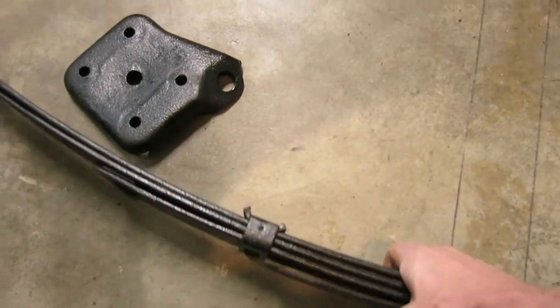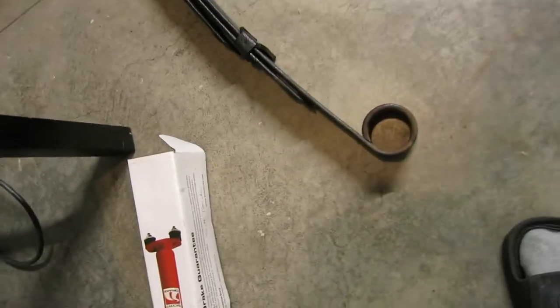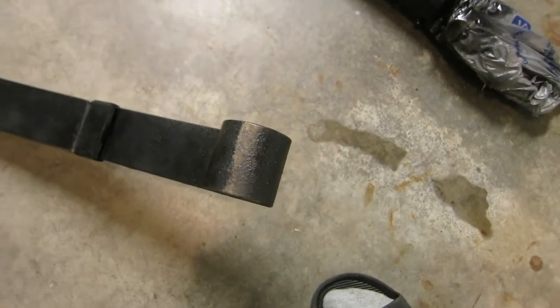Here is how the leaf springs turned out. One mistake I made was I didn't realize that the metal sleeves needed to come out until after I had already painted them. So I painted them and then wrestled to get those sleeves out, and they got pretty boogered up, so I'm going to have to touch those up. I'm not kidding when I say I probably spent two or three hours on one sleeve and it didn't budge. I thought about sticking a sawzall in there to cut it, but it seemed like a bad idea at the time. Fortunately I came to my senses, hopped onto YouTube, and found a video — I'll put the link in the description — of a guy that did just that. You cut two slits in the sleeve with a sawzall, pop that section out, fold it in on itself, and pop it right out. You should have the job done in five to ten minutes, realistically.